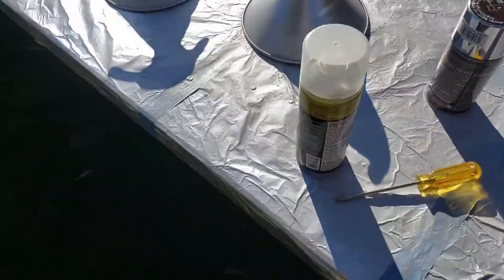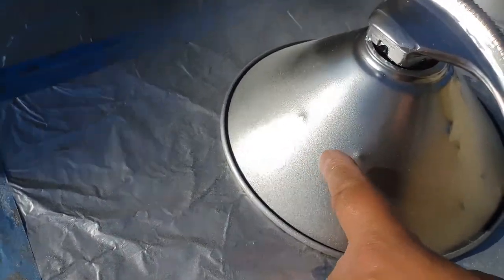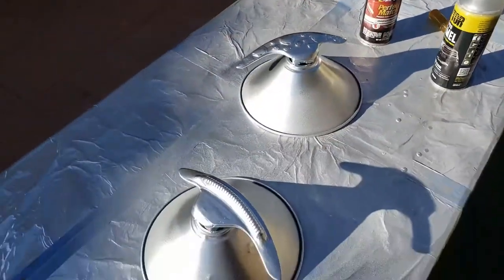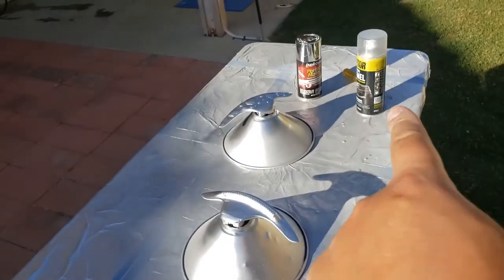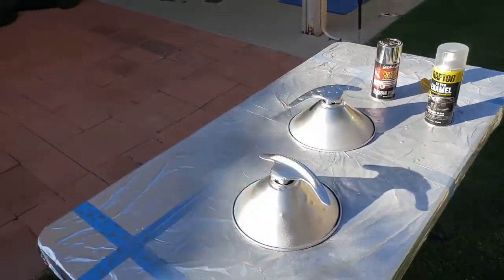All the sanding you'll need to do. But if you just do the diamond clear over the chrome, the chrome becomes very hazy — almost like that hazy chrome. But if you see the top it's super shiny — that's the chrome by itself. So I want the very shiny look. So I end up spraying a heavy coat of chrome on top of the clear while still tacky. But if I spray it after the clear has totally dried, the chrome is going to flake off.